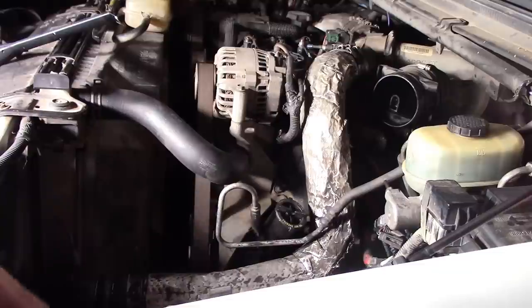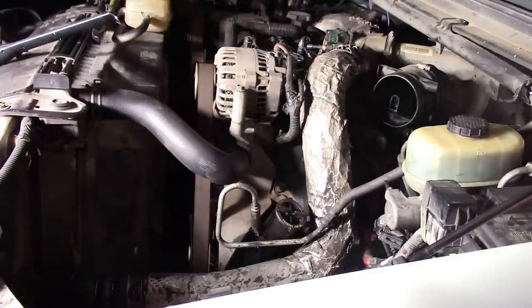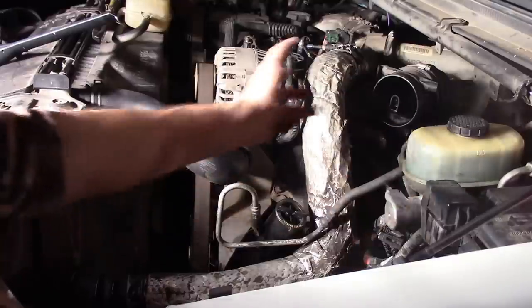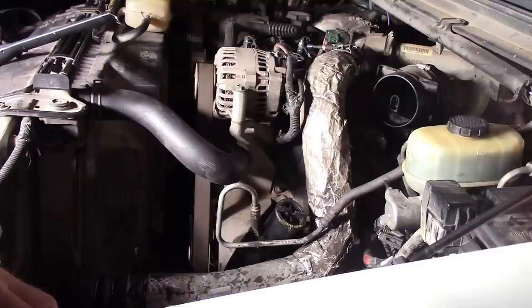It's remanufactured stuff — you never know. All I have left to do now is put the air cleaner and the battery back in. It does start and run with only one battery, which is good, but being diesel you want two batteries as much as possible for the extra amperage. That's how we change the power steering pump and the booster on this truck. If you were doing just the power steering pump, obviously you wouldn't do the booster side. If you're doing just the booster, you'd have just taken the lines off, pulled the booster out and replaced it. I hope this video gives you a little advice and helps you do it easier. Please give us a thumbs up, subscribe, and put any questions or comments down below. Thanks for watching, have a good day.